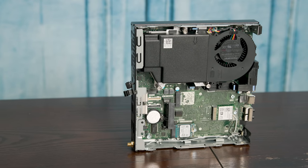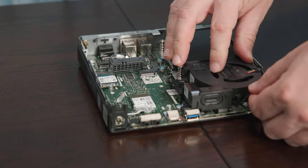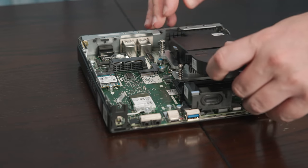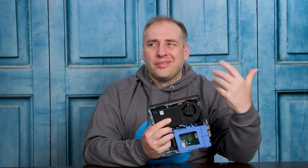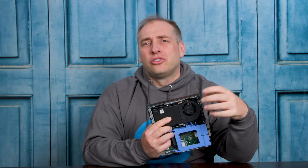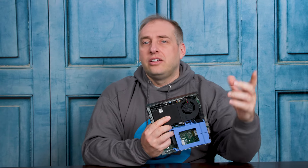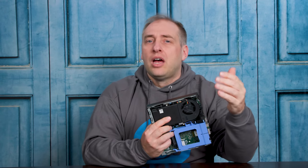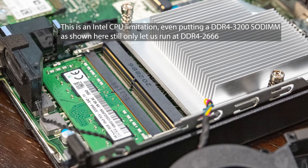I really like that i5 X500 or XX500 series because they're 35-watt TDP CPUs, and they tend to be pretty good value. You can also get features like vPro enabled with that SKU, whereas some of the lower-end SKUs you can't. That's a socketed processor under the heat sink and fan shroud. Under that shroud, which pops off with two clips, you get to the two SODIMM slots. One slight downside in this generation is that this is still DDR4-2666. If you get a Core i7 or Core i9, you can get up to DDR4-2933, but with the Core i5 here, we're limited to DDR4-2666 SODIMM speeds.